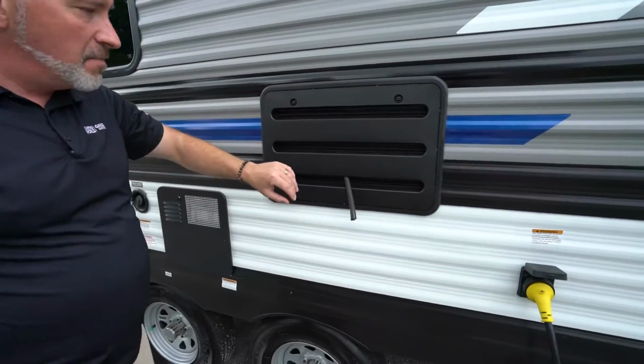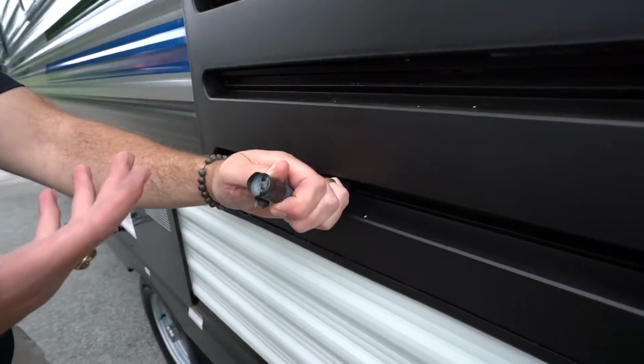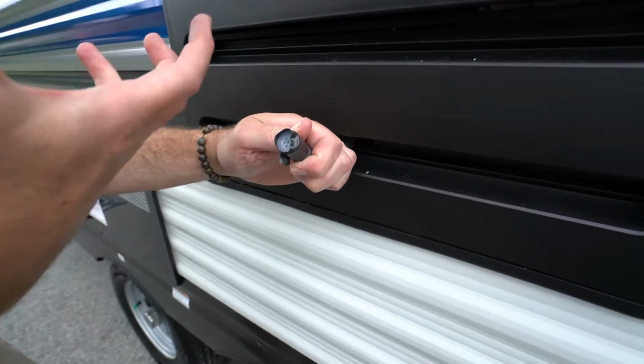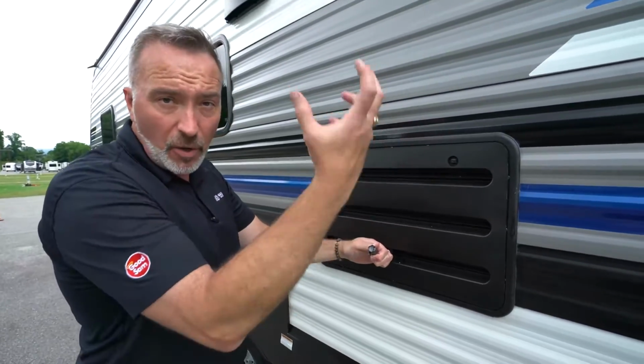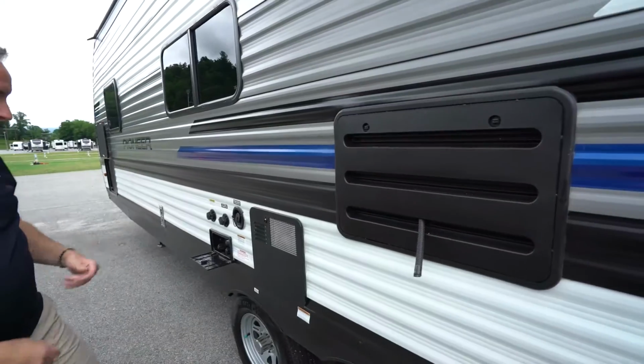This right here is the back of our Dometic fridge. And you'll notice it has this little tube. That's because inside this fridge, which is a gas electric with automatic switch, there's a little pan that collects the condensation from when this refrigerator gets too cold and the ice melts. This actually just allows it to drip outside of the RV.